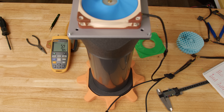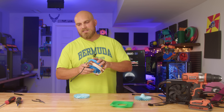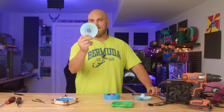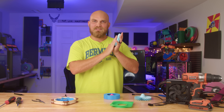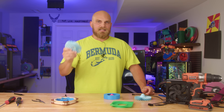The Vortex 9 came in at 5.4 millimeters of H2O, placing the Vortex 9 in first place, the GE TF34 X25 in second, the YACF in third, and the Honeycomb in fourth. Overall, they finished second, fifteenth, sixteenth, and twentieth, respectively. Today we learned that unfortunately the Honeycomb design — although very popular, and I can't imagine how many Honeycomb-style fans get submitted to the Fan Showdown — just never does that well. They look cool, but in airflow and static pressure testing, they just don't do it. We also learned that the Vortex 9 is simplistic perfection. Based on the smoke test, optimizing the gap and maybe the geometry of the fan could probably get even more performance out of it.